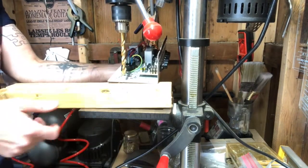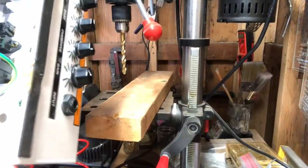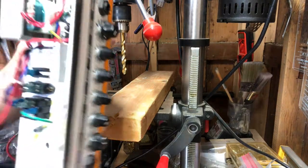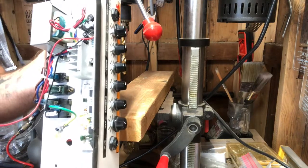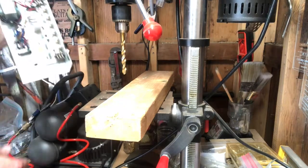You see there are all these metal shavings and we don't want those inside the amp. So I'm going to dump those out and then use my compressed air to make sure I've blown any excess out. Ideally, if you were doing this, you would take the circuit board completely out before you drill so that you wouldn't have any metal shavings under the circuit board.